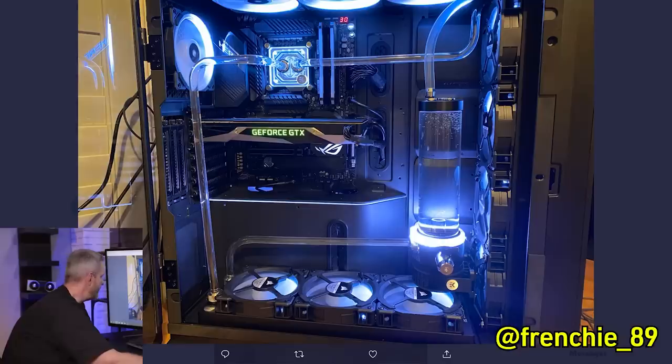You know right here, this piece is too wide, which is why you're coming off at this weird angle like that. So I would bend this 90 first, and then I would use this piece, the old one, as a template for where I should bend the next piece. And then I would say, okay, if it's bending here, bend it back there and use this guide next to it so you can kind of get that point of reference. My other suggestion too is if you find that hard line was too hard, then just soft tube it everywhere.